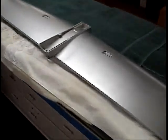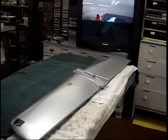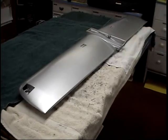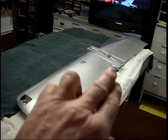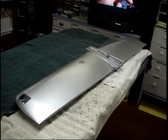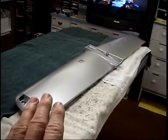I hope this is going to be the last coat, and it looks like I probably could cheat and not sand this out - but I don't want to take a compromise and take one chance out of a hundred. It'll only take a couple of hours to get this all sanded. What that allows me to do is get a total blend where we repaired the tip and where there's extra finish - it could even remove a little bit of weight. In the final finish, this wing being composite should have a really nice reflective quality with a minimum of the little ripples that make you crazy on a D-tube wing.